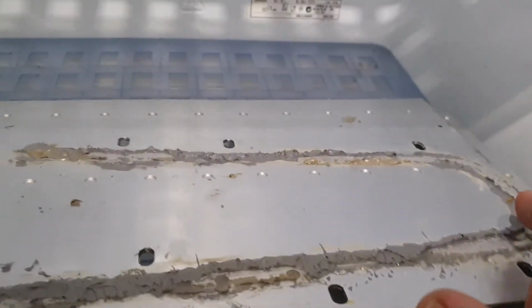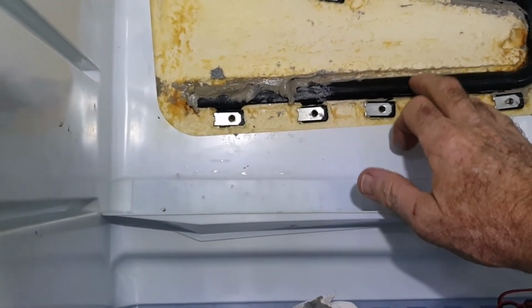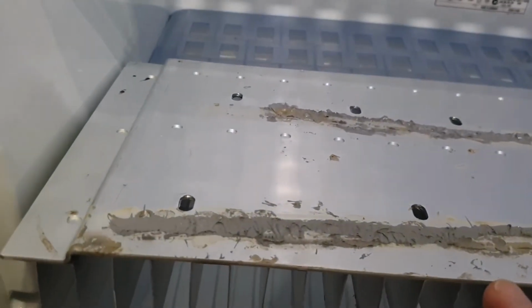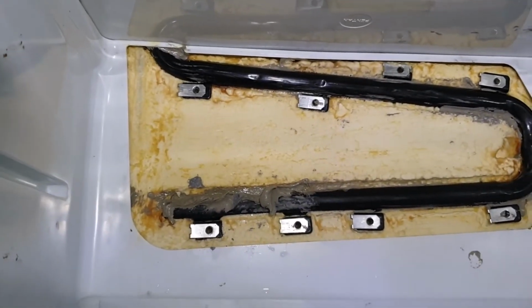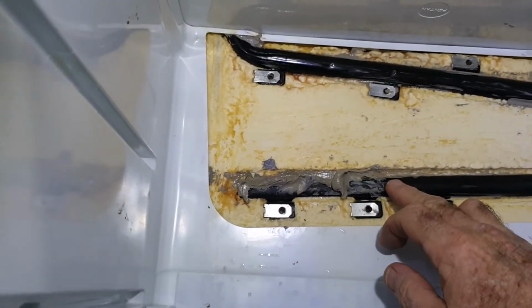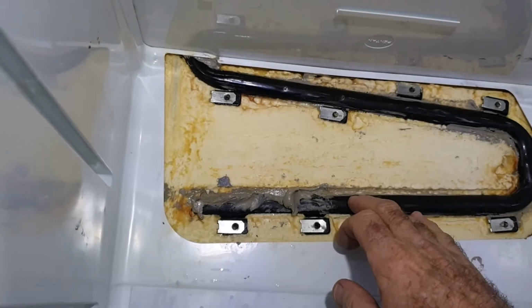So there were parts where it was clearly very sparsely populated, and the problem with that, of course, is that we've got probably a 20 millimeter pipe here, 3/4 of an inch, if you like, or something of that order, and that's mating to a flat surface. So the physical contact area between these two metal surfaces is minuscule. It's probably 1 millimeter, or a 32nd of an inch, is all the physical contact is. So this mastic's purpose, it has to have a good heat transfer rate, which they specify in watts per centimetre or micrometre or something like that. And if it deteriorates, then the transfer does not occur. You lose your efficiency.